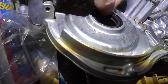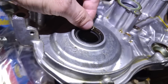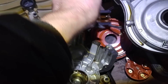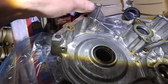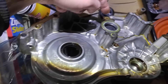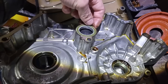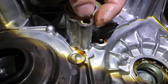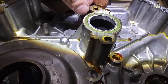I'm also replacing the camshaft seals. They're actually very soft and pliable, but I don't want to do this twice — and they're 25 years old, so might as well replace them. To seal all the valve covers, these surfaces all have to be cleaned off and new black silicone applied. There's also something on here that resembles a glue or lacquer rather than silicone — I'm not reusing that; it'll just be cleaned off.